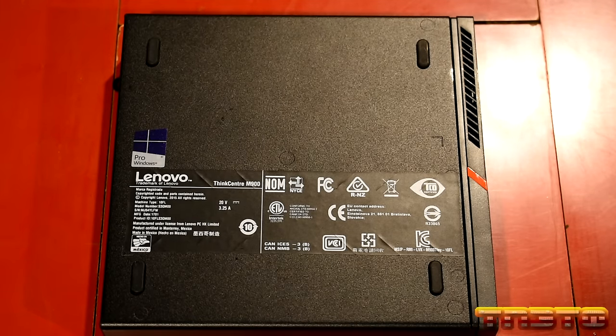And to get in the BIOS, as the unit is booting up and you have a keyboard attached, you're just going to keep hitting the enter button, okay? Okay, and then right here, you have escape to resume normal startup, F1 to enter the BIOS setup utility. So I'll do F1, and as you guys can see, probably not very well, we are in the BIOS. I will adjust the camera. So guys, we are in the BIOS now, okay?